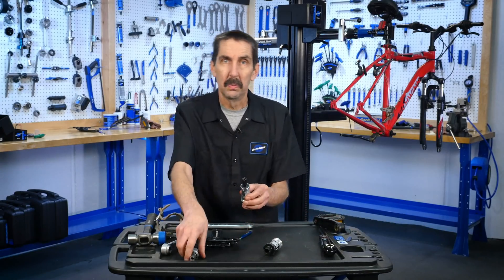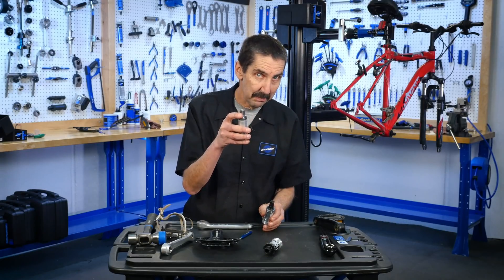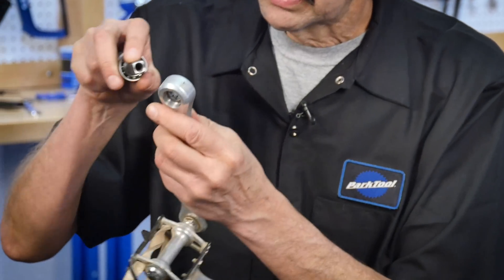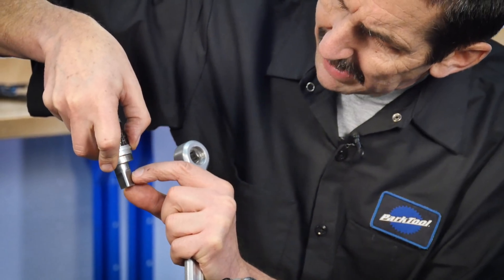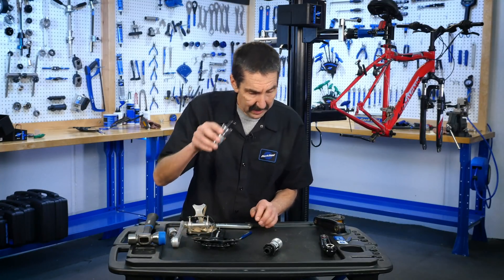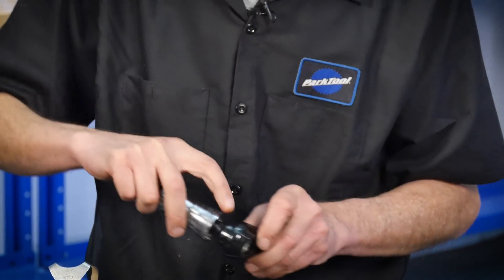We have what's called the JIS and we have the ISO. This is a steeper taper; this is a less steep, more subtle taper, and they need to match the cranks. This one you would see on the classic Campagnolo. A good fit — you want the spindle to come in but not all the way to the flat. You do not want the crank to go all the way back and hit the uprising section, the wall. Here we have the JIS and this would be a good fit — it's not coming to the end and we're not going to hit that wall. That is appropriate.